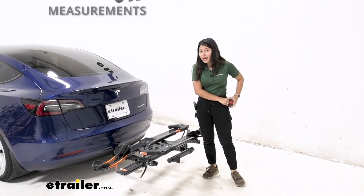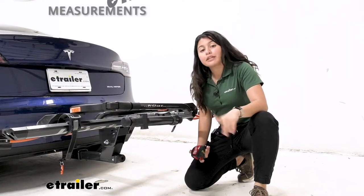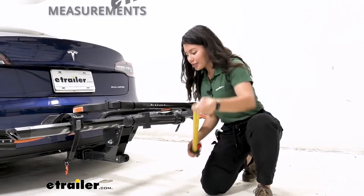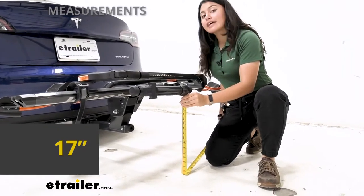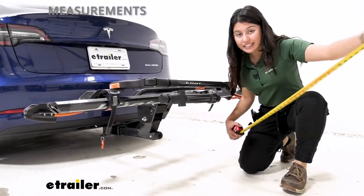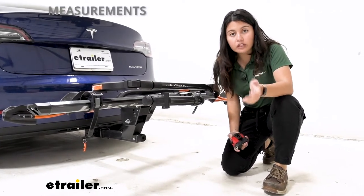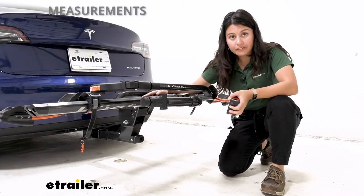Don't forget that you now have a bike rack as well as two bikes behind you. Where I would get worried is ground clearance, because your vehicle doesn't have much. Measuring at the end of the rack to the ground, it sits at 17 inches. But compare that to the shank to the ground — that's only seven and a half inches. So for any accessory you have with your Model 3, please try to get a shank rise just like what we have here.